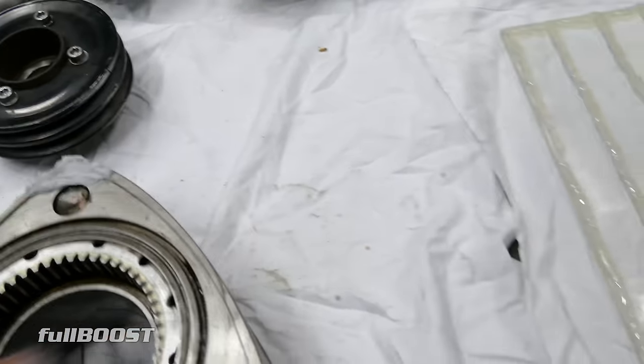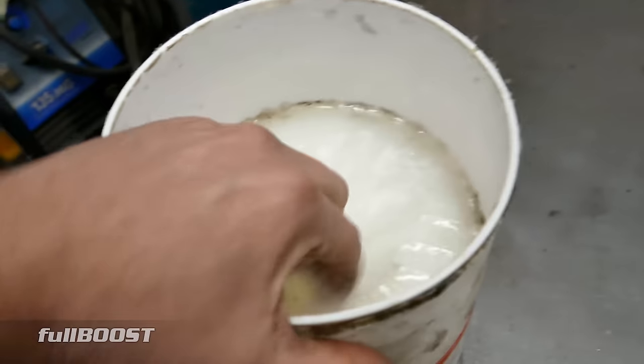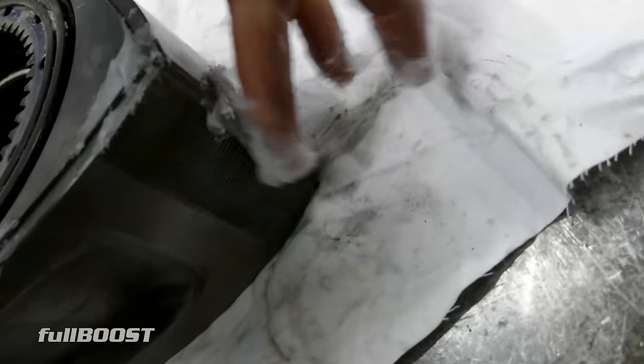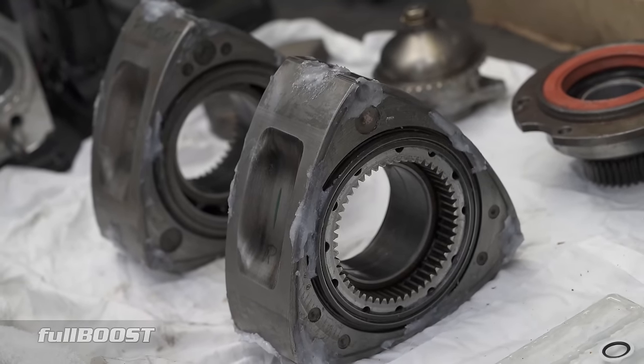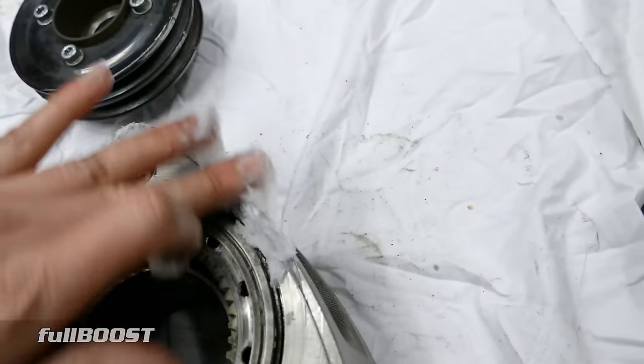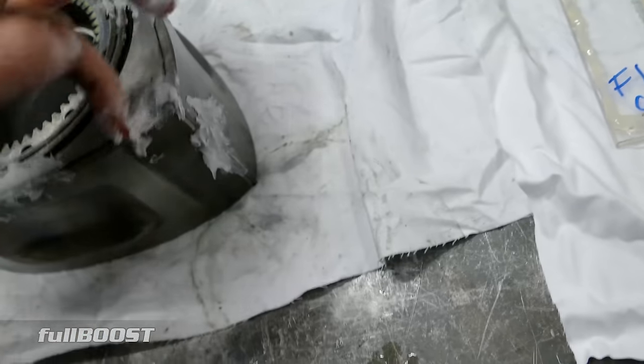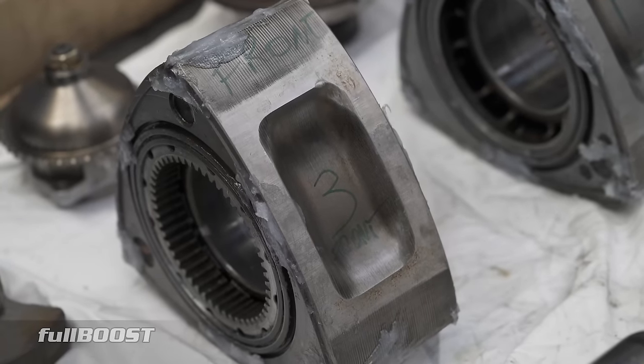This isn't so much for initial startup lubrication — it's more to glue the parts in place so they don't fall out when I tip the rotor upside down, because obviously I've done one side and still need to do the other. If you don't want excess Vaseline in your engine on startup, just before you install the rotors you can remove some of it. But it's petroleum jelly — petroleum-based — so it just burns off. No dramas. You just get a bit of smoke at first start, it all gets hot, melts, goes in the oil. Do an oil change and it's fine.